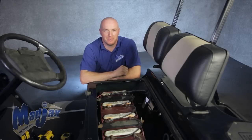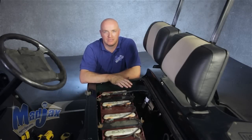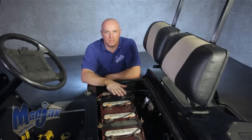Now we're going to attach our kit to the battery pack. First thing you want to do is switch your cart into tow. If you have 12-volt batteries, you need to use a multimeter to find one single 12-volt battery and attach your light kit to that. If you have an 8-volt system like we have here, continue watching on how to install a reducer to your 16-volt battery hookups. This will drop it down to 12 volts and it won't burn your lights out as quick. Once you have your kit hooked up, you can now secure your harness under the cart to the frame using the zip ties included in your kit. You're now finished installing your Mad Jacks light kit designed for a Yamaha G22.